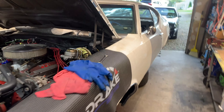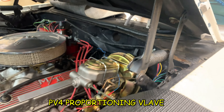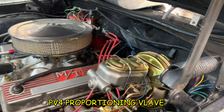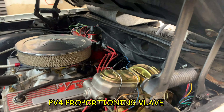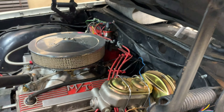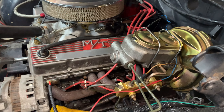We've got the four-wheel disc. This is the second booster we've put on here. We got this style master cylinder and we got the other style master cylinder — more square top — tried both. We've got what I believe is the correct rod inside the brake booster. The four-wheel valve is hooked up, and we have a line lock on it. We put all this stuff in here.